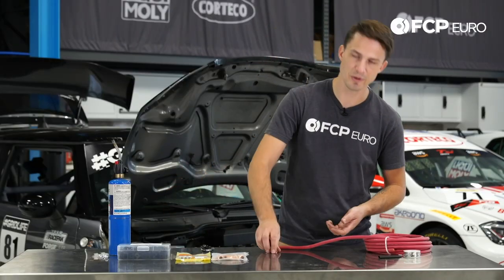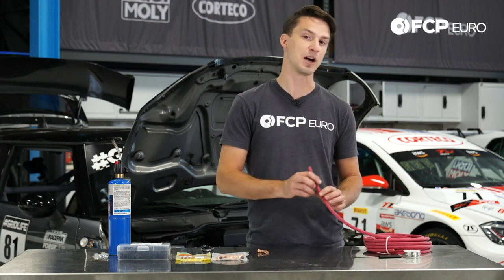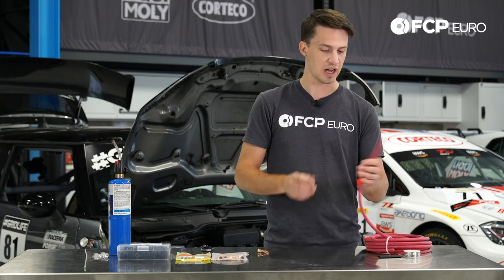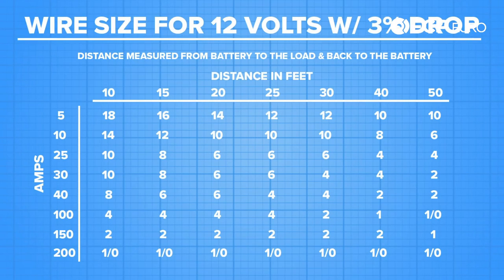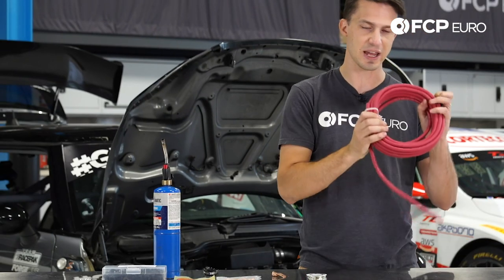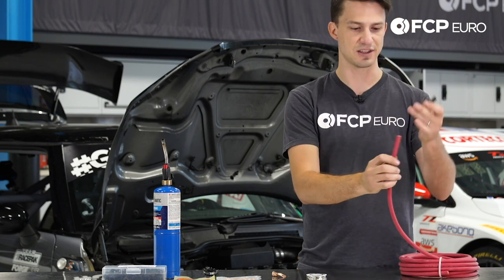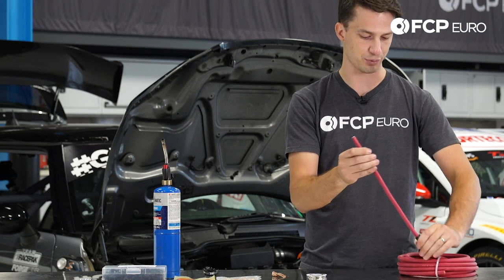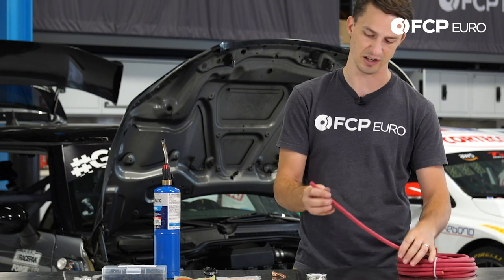The next step is we're actually going to hook the ends of the cables up to our new battery cable that we're going to run from the back of the car to the front. You're going to need to determine what size battery cable you want — we have a number two cable right here. That is sufficient for this little car to get enough voltage and amperage from the battery in the back all the way to the front to start the car and run the engine. I would use a chart to reference how much voltage and amperage you need from your battery to your engine over the distance you have to travel. We're going to use the entire cable since we don't know exactly how we're going to snake it through the car — we'll leave it all wrapped up and we're going to slide the shrink wrap right down it. You want to get the shrink wrap pretty far away from where we're going to be heating it up — the last thing we want is to accidentally heat it up and not be able to move it.